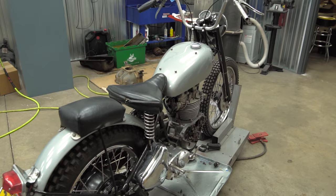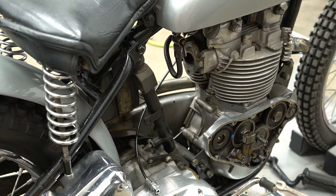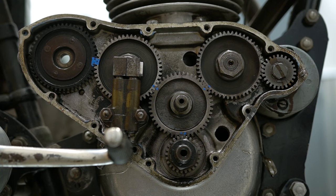The second item was these fuel lines. A couple of them are missing and the carburetor was stuck. The carburetor has actually just been soaking in parts cleaner to clean up the outside and get the general varnish and gunk off it from sitting. I need to pull that apart. I have some fresh gaskets for it — make sure that silly stuff like the float needle is not sticking and all that.